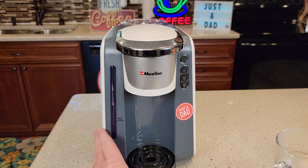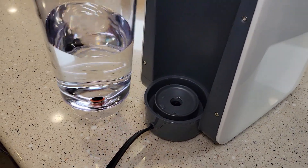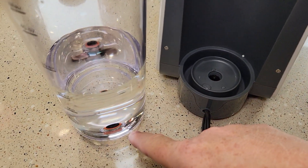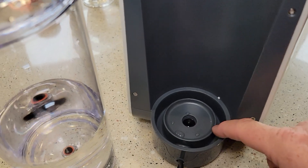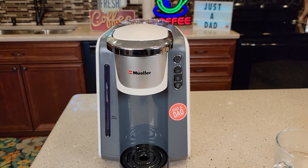Other than the clogged needle, maybe it's not brewing the right quantity. This is a very nice, very simple coffee maker — there is no descale light to prevent you from brewing if you haven't descaled it. I'm going to do a separate video on how to descale it with vinegar. If your coffee is not as hot as it used to be, or if it's not brewing the right amount of water, it could need to be descaled — you should descale this coffee maker every three to six months. Also make sure nothing gets down in the reservoir area, as it can prevent the water reservoir from seating properly and you won't get water into your coffee maker. So I hope I helped you fix your coffee maker — please like and subscribe.